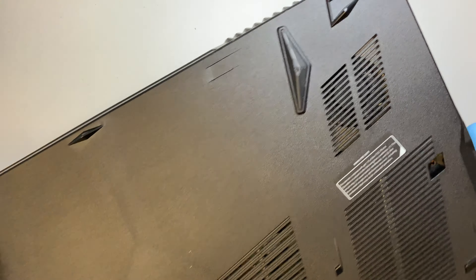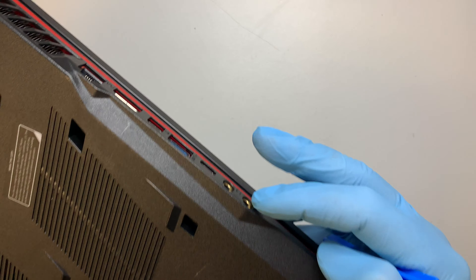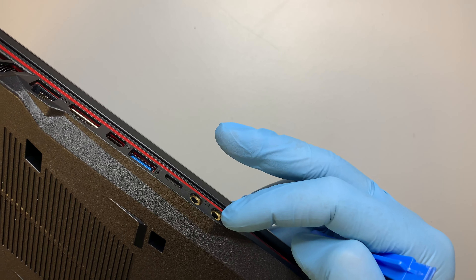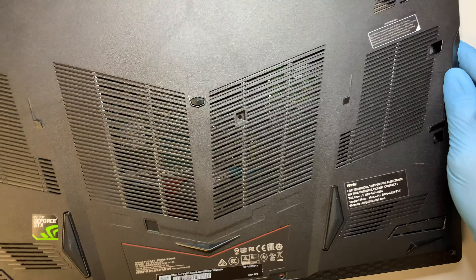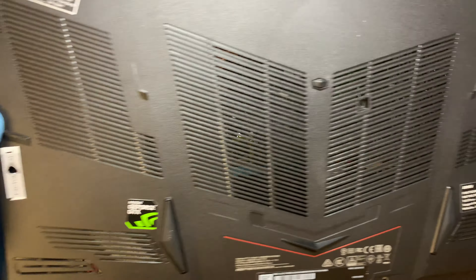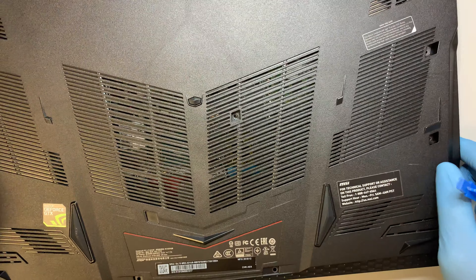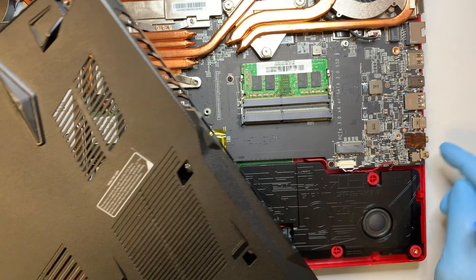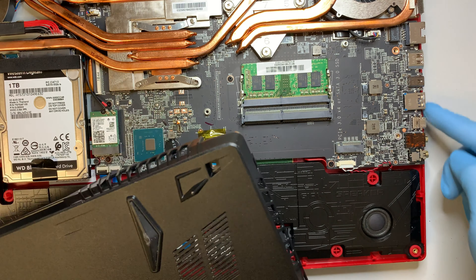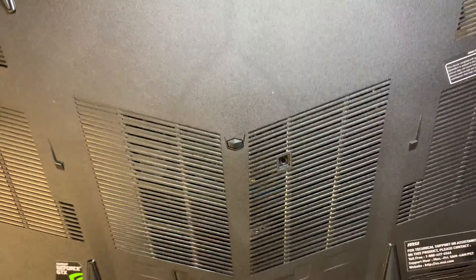Pay attention here — on one side you have the audio jack and the microphone. I usually like to leave this as the last portion to move. I'll lift the corner here and then move slowly towards the microphone, because sometimes it's still tight on the microphone side. If you leave the plastic on the microphone, you may actually damage the connector or the USB. Either way, the goal is to remove the back plate.